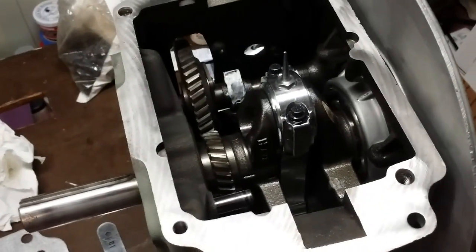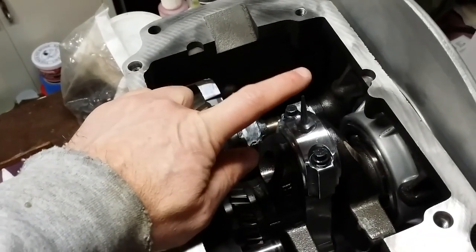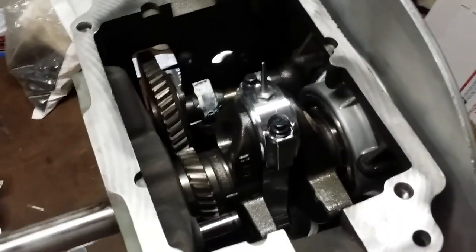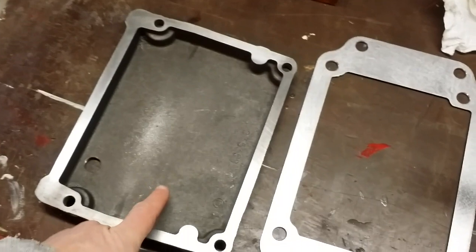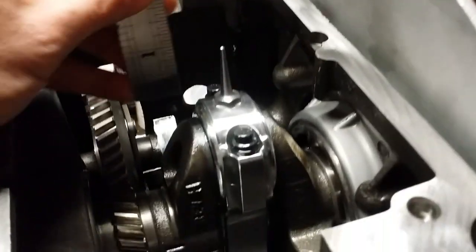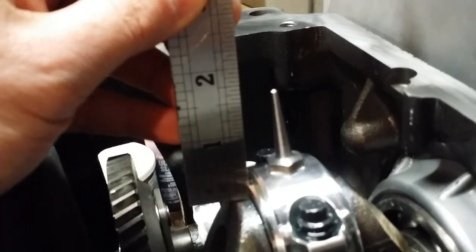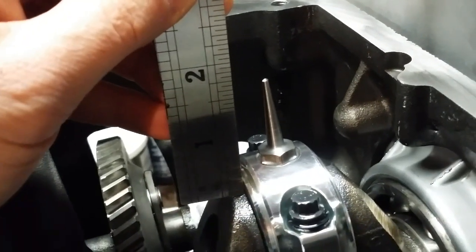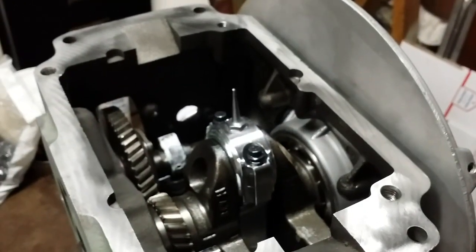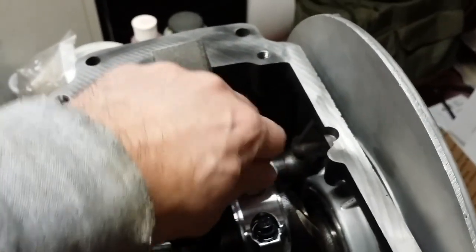With the stock Kohler rod and a thin oil pan, the distance from the crankshaft to the end of the dipper is 2⅛ inches. So I need this to be less than 2⅛ inches so that when it's running it doesn't interfere with the oil pan itself. Taking my steel ruler, we're measuring at roughly 1¾ inches, which will clear the oil pan. We're all set.